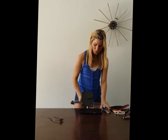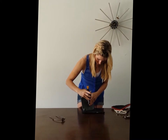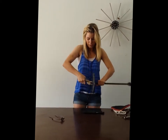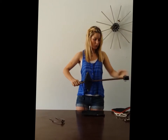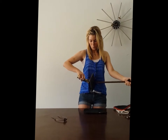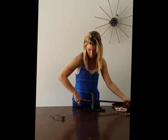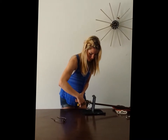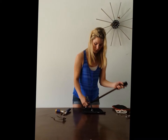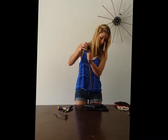It sounds really strange but when you see me do it you'll understand. So what you're going to do is clamp on your pliers and you're going to twist. You have to hold this at the same time while you're twisting so that you can get this nut off the bottom of the base. Once you do that, you're ready to pull the lamp rod out.